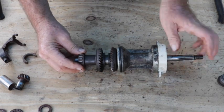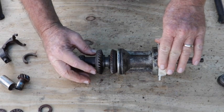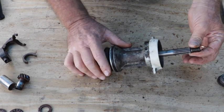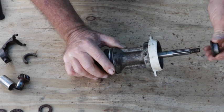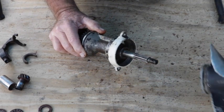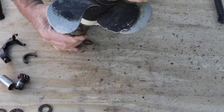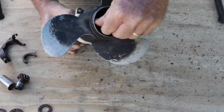Then you're going to have your bearing and the bearing cup or race — the race is in the lower unit. After that your thrust bearing goes up here, then your propeller. Then you put on your thrust washer on the outside and put the nut on.